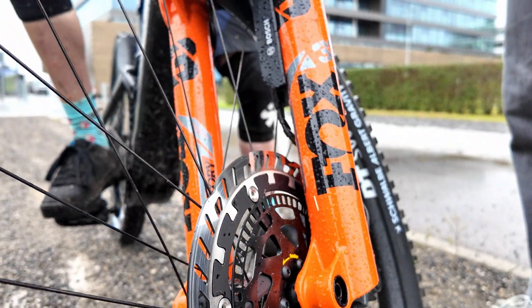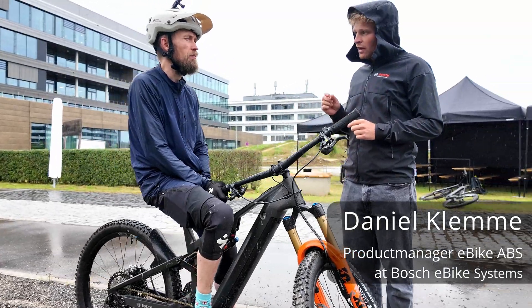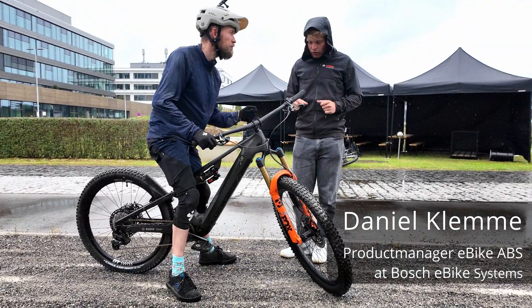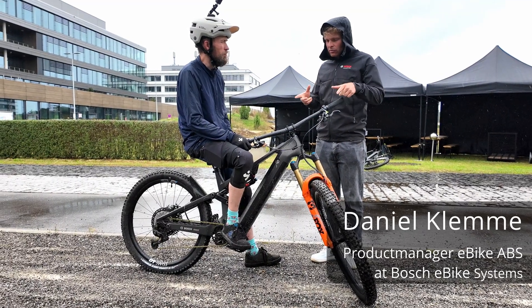I really like the ABS Trail Pro function — it's something I would use on my local trails. It's basically the same technology: a pumpless one-channel ABS system for the front wheel only. But we changed valves to achieve faster opening times for riding faster and changing riding surfaces to adapt brake pressure. We also have a smaller accumulator size, but it gets empty and refilled faster.